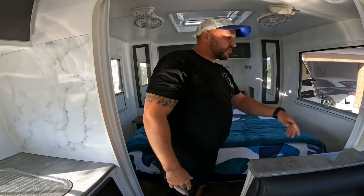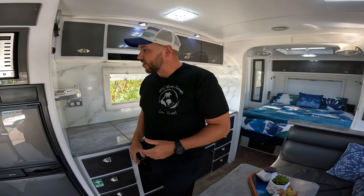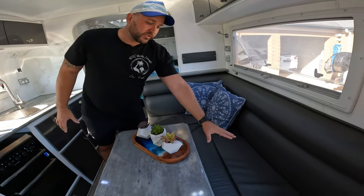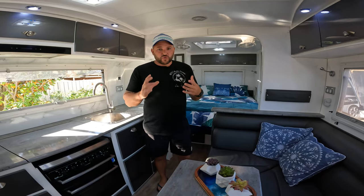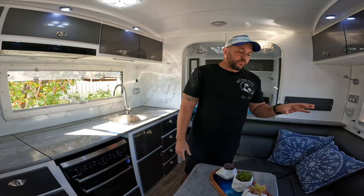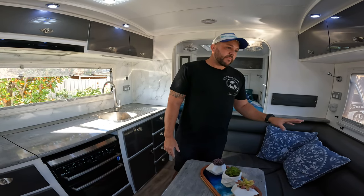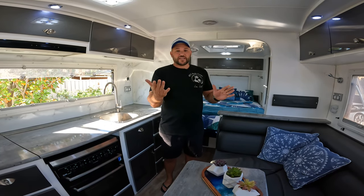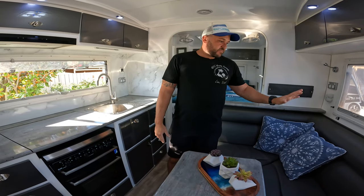There's plenty of storage under the bed and corner cabinetry — we travelled full time in this van for nearly 11 months with no storage problems. The entire 12-volt system has been overhauled with new wiring, fuses, isolators, and breakers. In total, you've got 400 lithium amp hours — two 200Ah DCS lithium batteries — and you can monitor battery performance via the DCS app. We've gone Victron products for the rest of the 12-volt setup: a Victron MPPT 50-amp solar regulator and a 30-amp Victron battery charger, all Bluetooth-enabled so you can monitor solar watts, volts, and battery charge via a Bluetooth app.